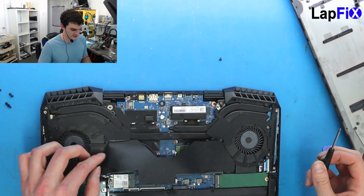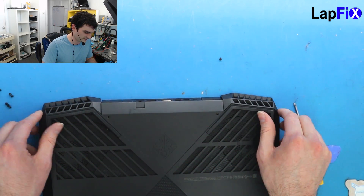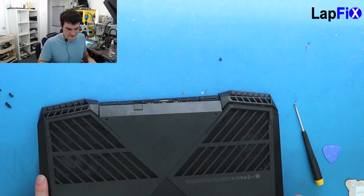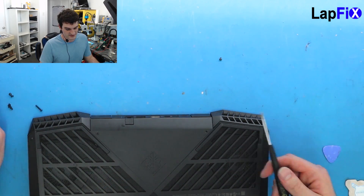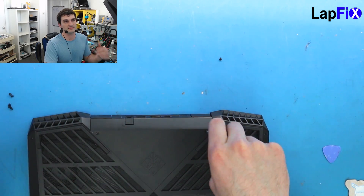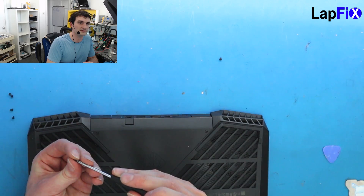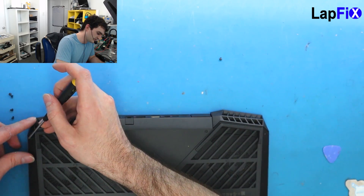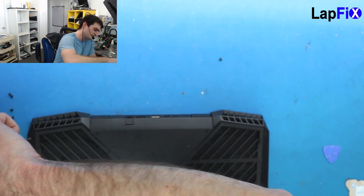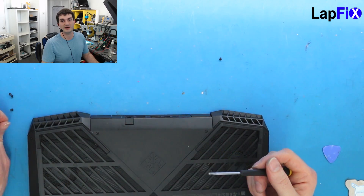He does complain that he gets a little bit of lag and hitches every now and then. I did mention to pretty much buy a desktop — it's the best way to go. Especially these laptops aren't exactly meant for long, long periods of use compared to desktops. Even desktops don't do a great job over very long periods of gaming. They do get really hot. The best we can do is just what we did here — it's going to help his thermals a lot. He should have less hitches and more performance. Once it gets so hot it needs to throttle down, you're going to lose some performance. That's why people liquid cool. You do all these things with desktops to make sure the processor and GPU are as cool as possible. If they're as cool as they can be, they can overclock a little bit better, run a lot more optimally, and even have a longer lifespan over time.